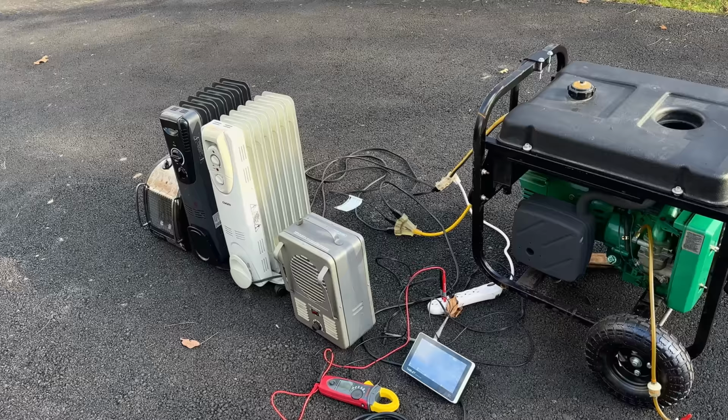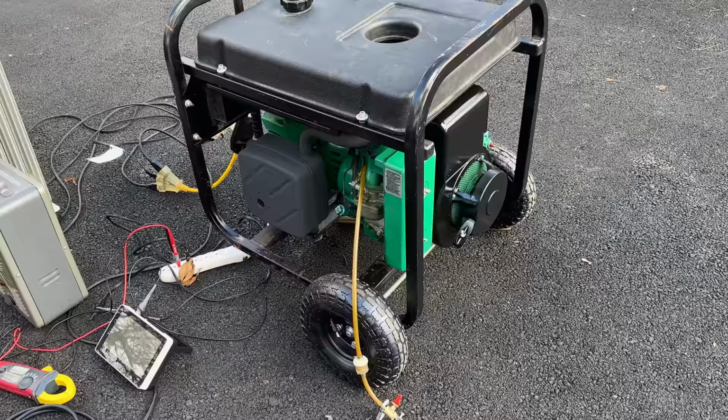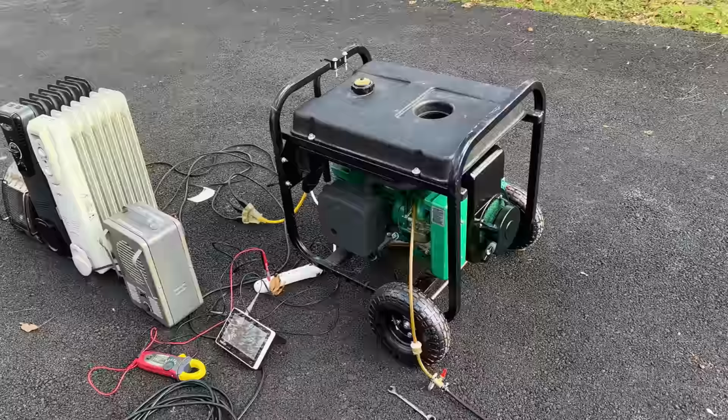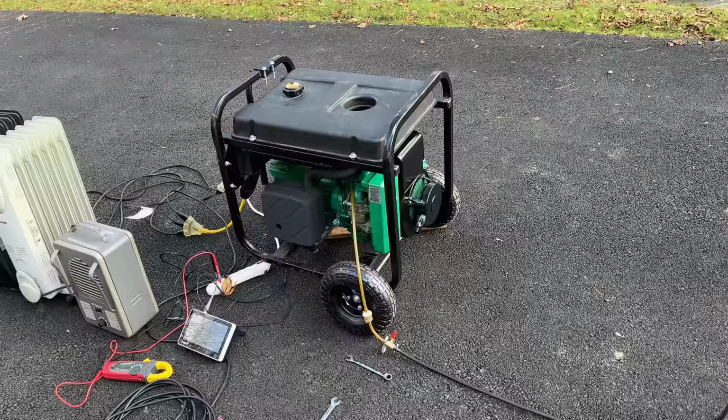And then I took the load off and saw that the engine was now running too fast. Without a load, it was at 64 hertz. So I backed that spring tension off a bit, down to 62 hertz. We tried a full load again just to make sure things could hold at 57 hertz, and it did without issue. Then when I took that load off, again, the engine speed was a little bit high at 63 hertz. I gave it a minute for the engine to cool down, and I saw that engine speed dropping. It quickly came back down to 62 hertz, so that's pretty typical. I don't think we have any issues there.